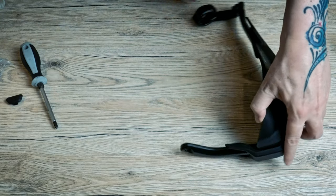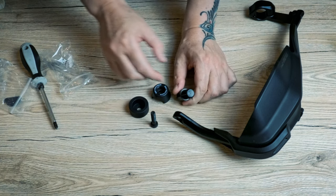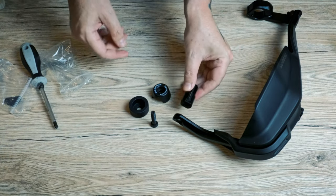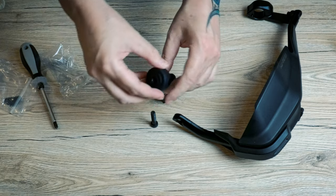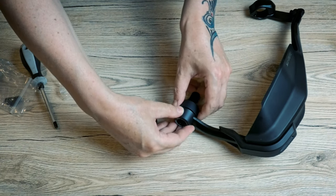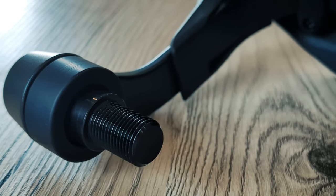So this is all together. For this end we have these three parts and a big bolt — the biggest bolt in the pack. This one comes into the OEM handlebar and you just remove the weight and put this one into the handlebar itself. After it's done, here is this washer with a big hole — put it in like this. Then this weight — this is heavy — just fits right here. You cannot rotate it because it's shaped. Put the big bolt in here and this goes all the way in. It's supposed to work on your motorbike like this.